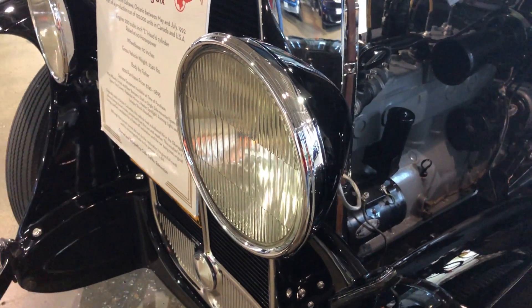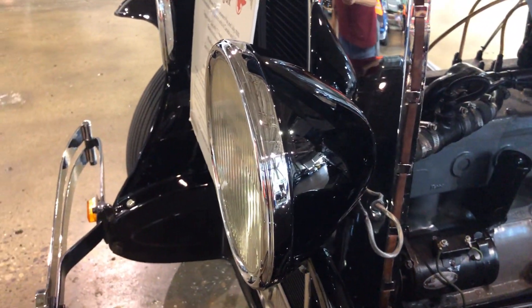And all the electrical — obviously when the restoration is done the electrical is all redone — anything modernized? Nope, it's all a six-volt system, and it works quite fine. The generator and starter and everything else is all six-volt. The headlights — they're not as powerful as the newer ones, but I don't drive it much at night anyhow.